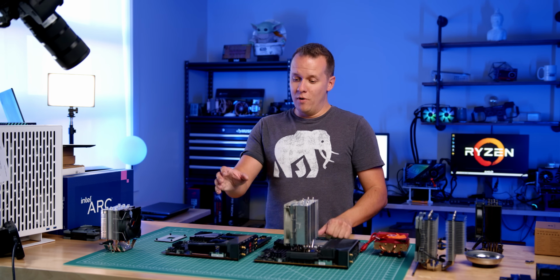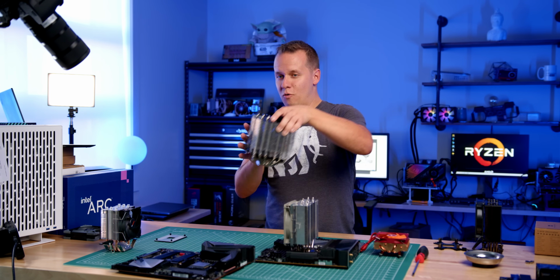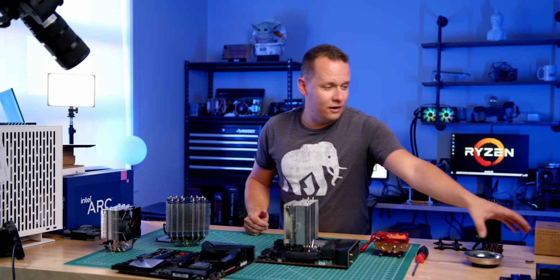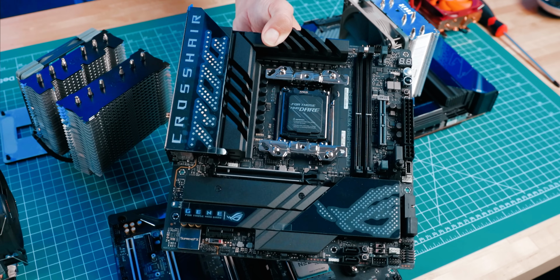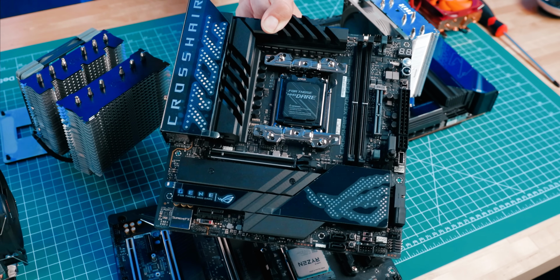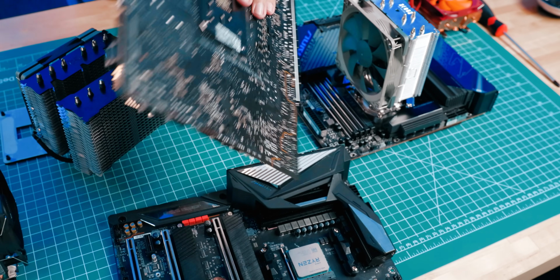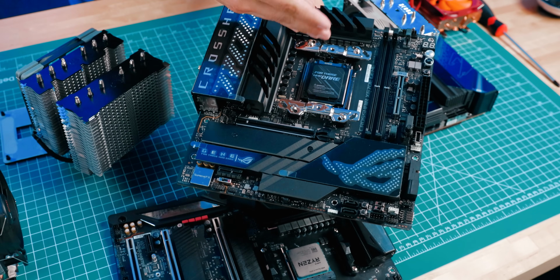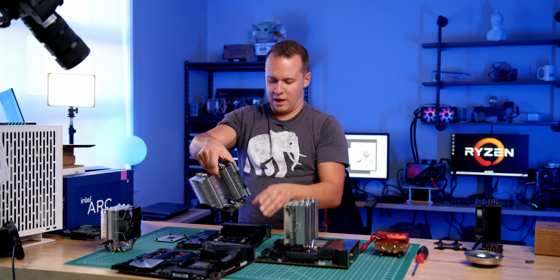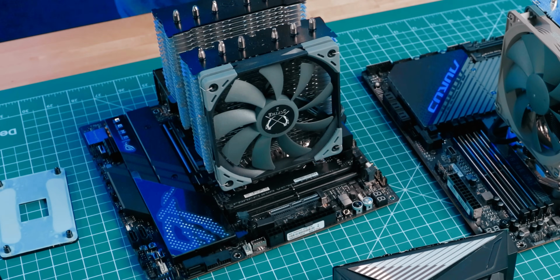In addition to that, we have been running, guess what? One of my favorite coolers of all time, the Fuma 2 OG, the original one, this whole time on an AM5 motherboard, and it is basically right here. Look at this. So these two retention arms right here are from the original Fuma mounting kit. It isn't technically AM5 compatible, but because guess what? It reuses the stock AMD backplate on AM4 and now is compatible with AM5. This thing right here, guys, this mounts without any issue whatsoever. The mounting pressure is perfect and the performance is actually really, really good too.